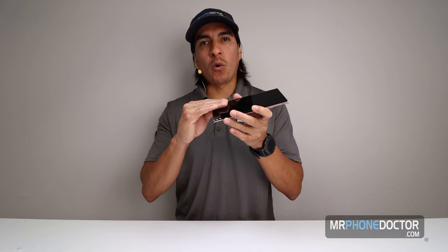You guys are in for a treat. Today, I'm going to be showing you guys how we replace a cracked front screen on a Samsung Galaxy Note 20 Ultra. Now, this process will work just fine as long as your display is fully working, digitizer touch is responsive, and there is very minimal bleeds or any kind of blemishes. Now, if it does have some bleeds, we can attempt this repair, but it is a little more risky because during the lamination process, we do put a little bit of pressure on the OLED when we're laminating the glass and OCA back to the display. So just keep that in mind.